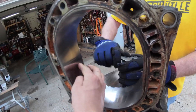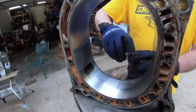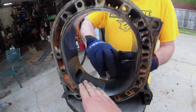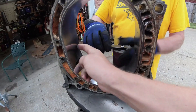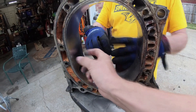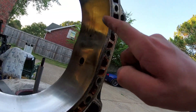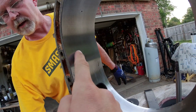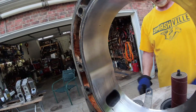The edges aren't as sharp as they were before. There's definitely some dirt and stuff down in it now. I wouldn't be so much worried about the apex seal catching and grabbing on that, but you'd definitely see over time this would start to grow and spread, and it would chew it up. But it's getting better. You can definitely see in this one — before over here and after over here — big difference in the uniformity between the two.